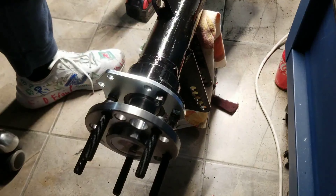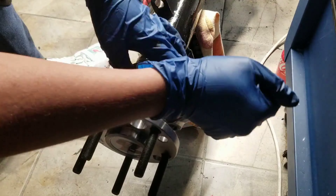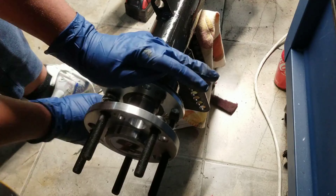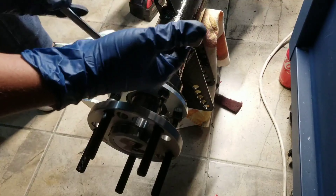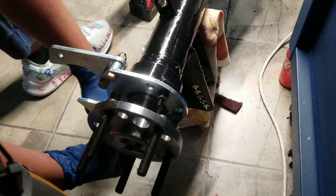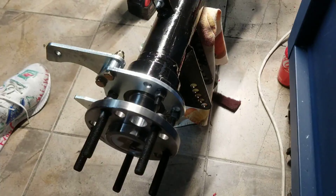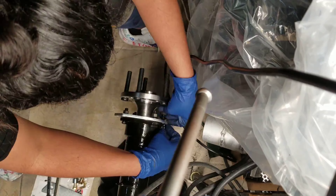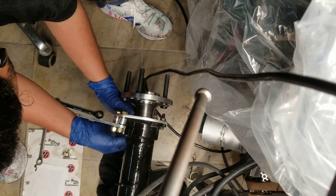Running that whole piece stainless braided for the housing gives you a hell of a lot of deflection — there's no way I'm doing that. You can do it, probably doesn't matter, but if you've ever had a really good brake system you'll know the difference. You want a very consistent pedal feel.